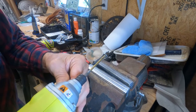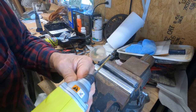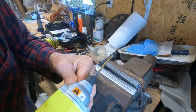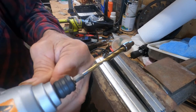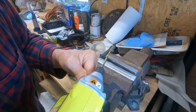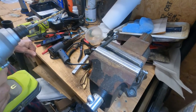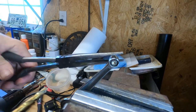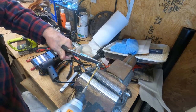I'm thinking once it goes through and breaks through the center, you keep the drill against it because that little flare at the end will come loose from the post. We may need a bigger one — no, it's still going. I've noticed that the back side wants to turn, so you might want to use something to hold it so it won't turn. Put a little bit more pressure.